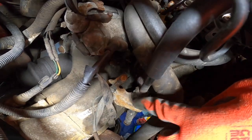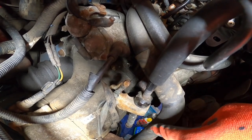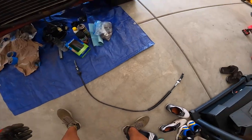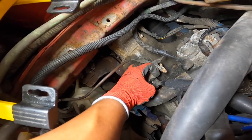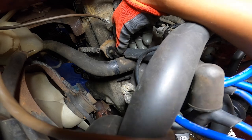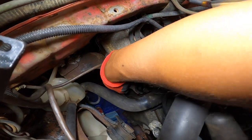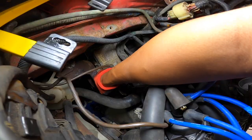Right here is the clutch cable adjustment that attaches directly to the shifter linkage, so we're going to go ahead and loosen that up. If you take a look at our new cable, this is the side we're loosening — just unscrew and loosen it as far as you can get it. Next we're going to disengage the actual cable from the linkage. The actual linkage is down here and it's like a hook — you just toss the wire around that hook and pull on it.